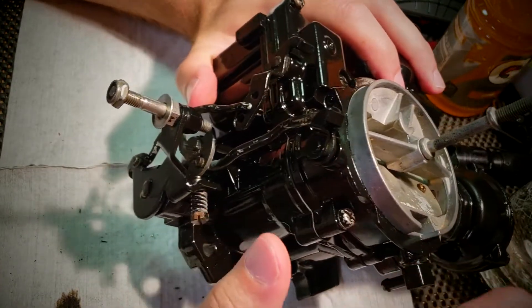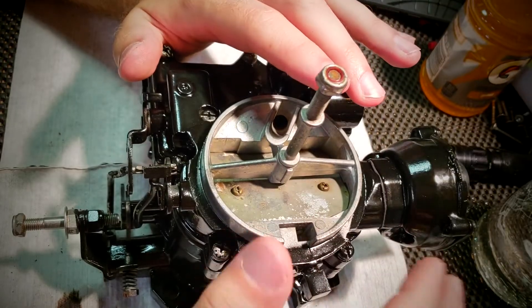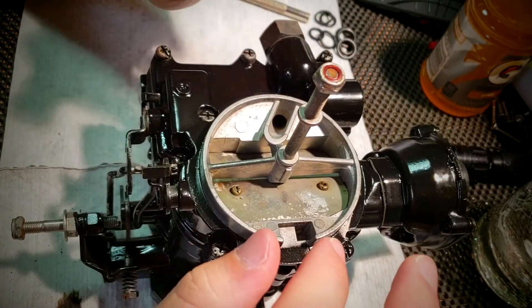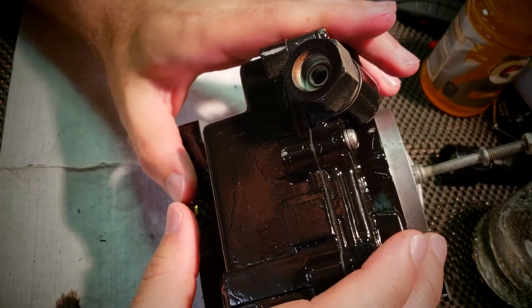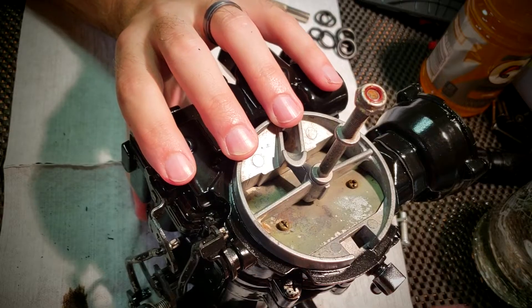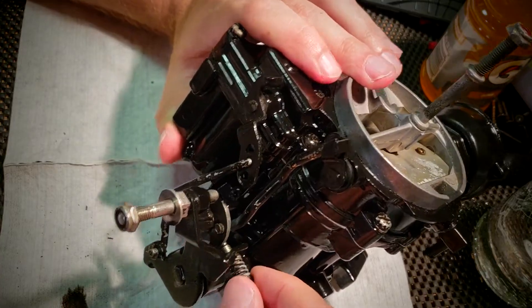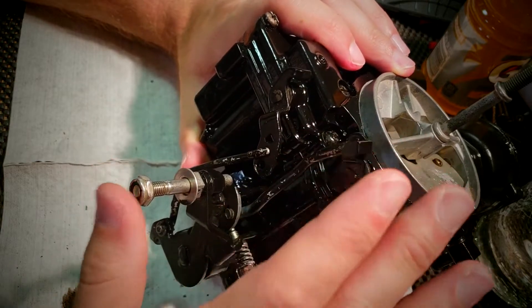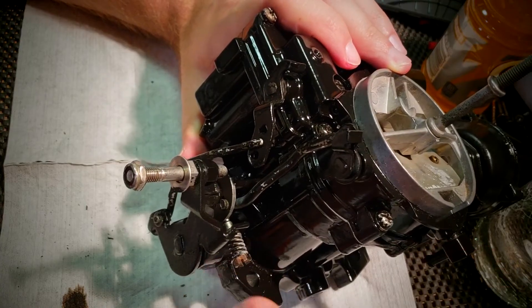The key point here is this next part is going to be done on the boat. Once this is in the water, you're going to want to start the motor, get it up to operating temperature until the choke is fully open. We're going to want to adjust the idle mixture screw in the water, in forward gear, in the idle position though — you don't want to rev it up to the throttle plate being open, you just want it just clicked over into forward gear at idle. Once we're in that condition, we're going to tune the idle speed screw until it's idling around 600 RPMs. Ideally you're going to want to use a shop tachometer for this just because boat tachometers are notoriously inaccurate, especially at low RPM. So if you have a shop tach, use it here.